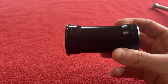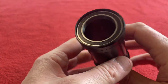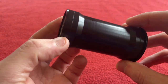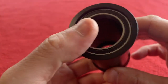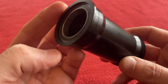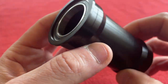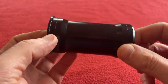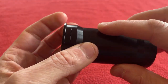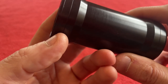He makes his own bottom brackets, and this is the version I'm gonna need for my bike. So it's a proprietary heat treated alloy, stiffer than standard by 20%. It's made to aerospace tolerances, guarantees a no-slop fit with good retention. One piece design is inherently crank creak-free. It uses NTN or NSK ultra low friction bearings, no hammers to install or remove. It has a one year warranty, supplied with fitting adapters.